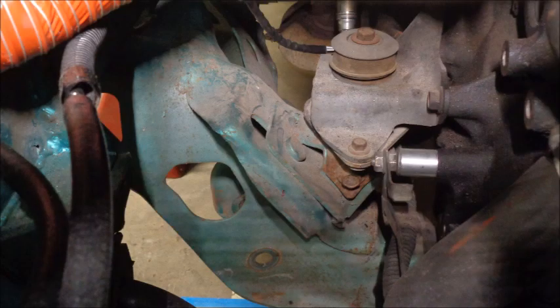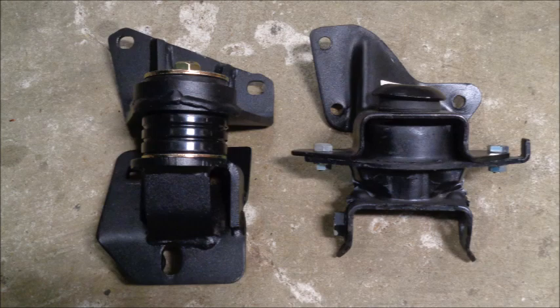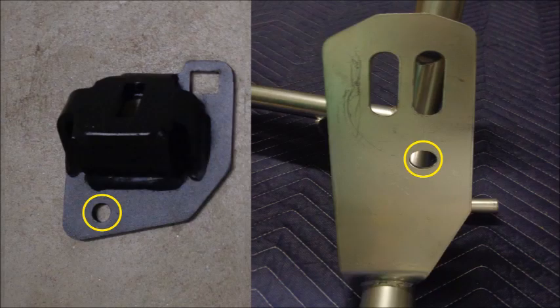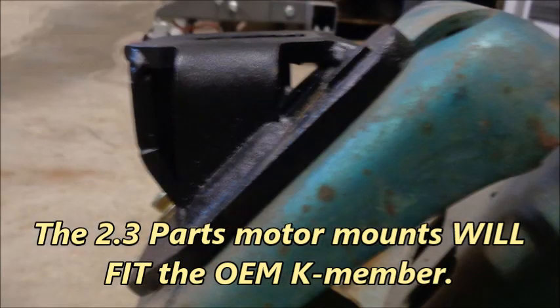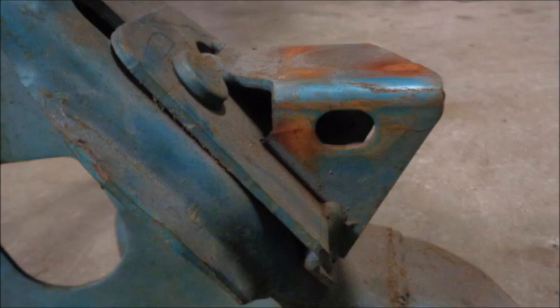This car is going to be thrown around a lot, so I wanted much stronger motor mounts. I found these beefy polyurethane motor mounts from 2.3 Parts, and they are clearly an upgrade over the OEM motor mounts. They come with all the necessary hardware and simple instructions. But when I mocked them up on the UPR K-member, they didn't fit — the smaller holes didn't line up, and the passenger-side bracket didn't sit flush against the K-member. The 2.3 Parts motor mounts will fit the OEM K-member, but it turns out the UPR K-member wasn't designed to work with the OEM 2.3-liter motor mount brackets.